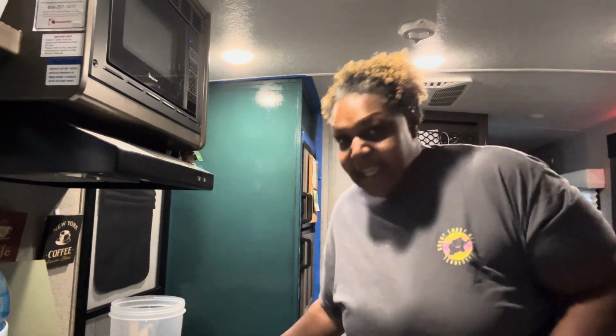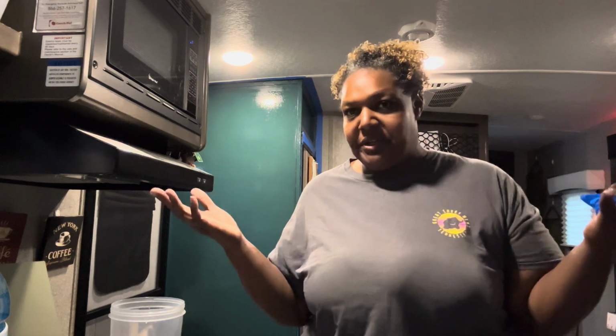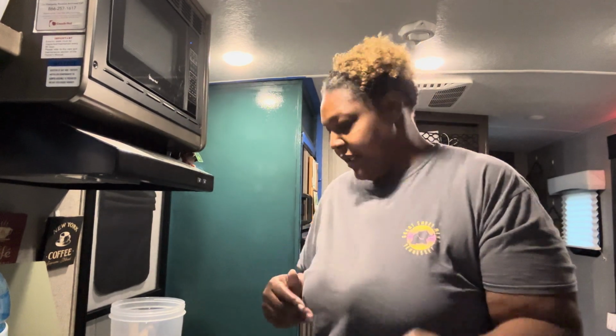So when doing a camper, one of my top recommendations is get a fast drying primer because you're in a small space. You want to ventilate, and you don't have time because you don't have a lot of places to put your stuff. You don't have a lot of time to wait a couple days for stuff to thoroughly get dry, right? So get something that's like an hour dry and then an hour dry on the paint, but you're really going to give it like 2 or 3 hours. So what I'm saying is get something that if you need to, you can get done in a day or so, right? And not in 2 or 3 days over time, unless that's how long it takes you.